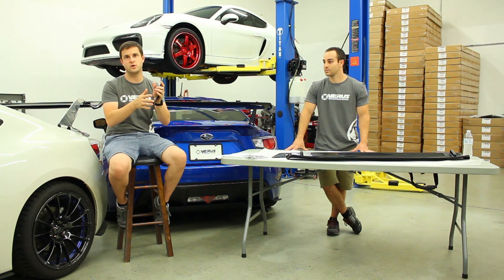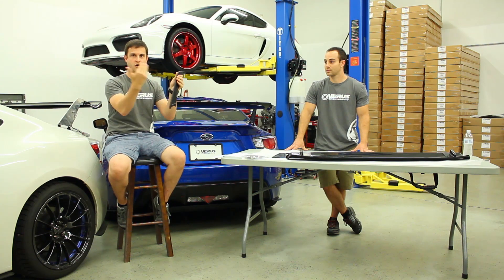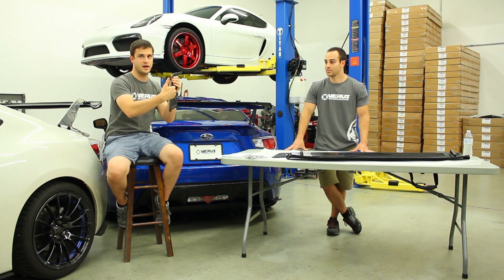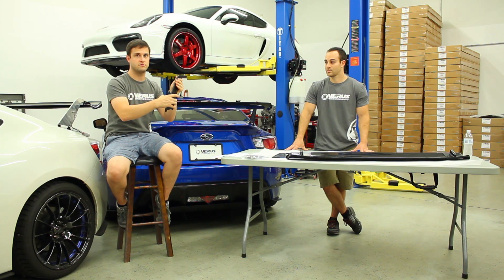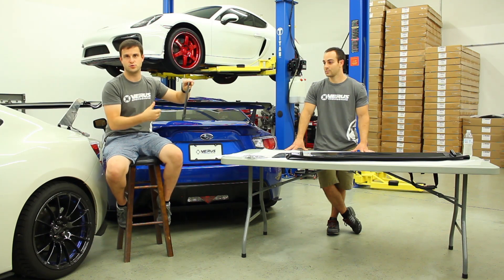Aerodynamically, the problem arises when the car sees airflow at a yawed angle. If there's a crosswind or the car is mid-corner, airflow is not going straight onto it — it's coming at an angle. If the uprights are cut out and they're in front of the wing, it creates very dirty flow coming off of them, which hurts the airflow to the bottom side of the wing — the critical part. You end up losing downforce and increasing drag, two negatives we didn't want.